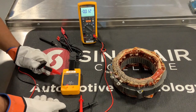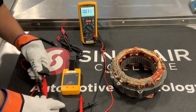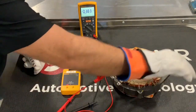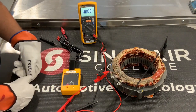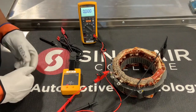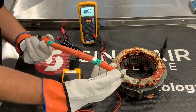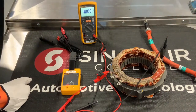I've got a motor winding here out of a second-gen Prius, referred to as MG1. This is something we're doing on the bench because it's easy and useful for a demo. In practical purposes this would be done on the vehicle — you'd go to a main harness or something going to the transaxle and find your three main cables to the motor winding. I could also do the same test on a cable from one end to where it mounts to the case. I can bug one of these so it won't pass, just to have an activity for a class.